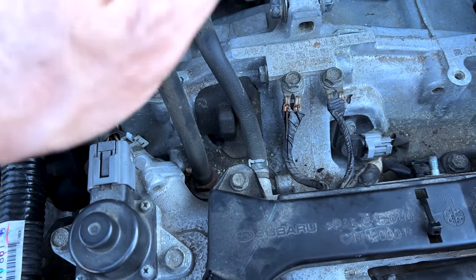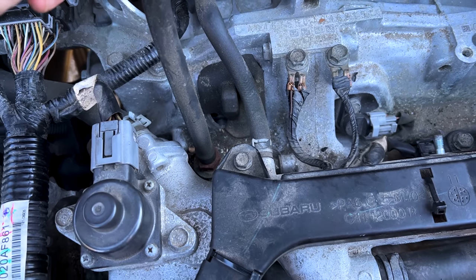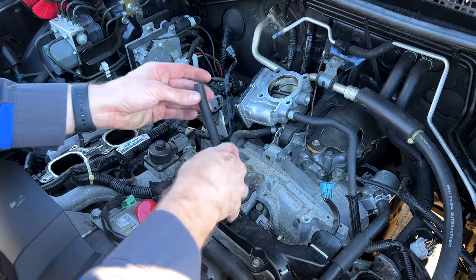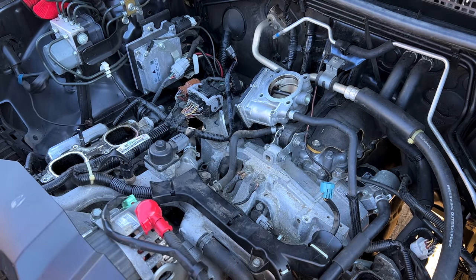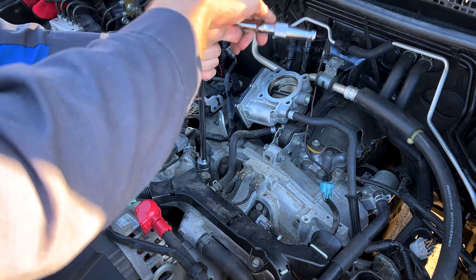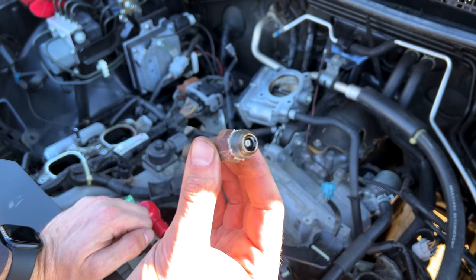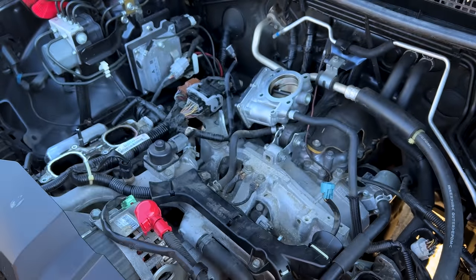Now what we're going to do real quick is replace the PCV valve. The hose is nice and rock hard, and the valve has probably not been replaced in a while. So we're going to go ahead and pop this hose off and pull that PCV valve out of there. We need to go ahead and remove our PCV hose and our valve — and yeah, that rubber is that brittle that it just snapped right off, so that's why we got a new hose. Go ahead and pull the valve off and see if we can get the socket over with the piece of hose on there. And got that out — yeah, nice and crusty and rusty. Old shake test, not making any noise, so we'll throw that in the junk pile.